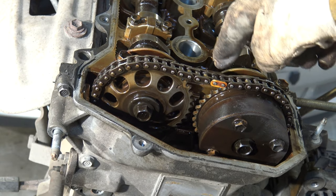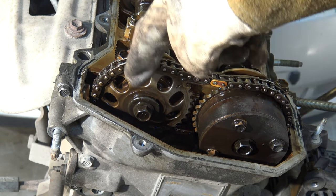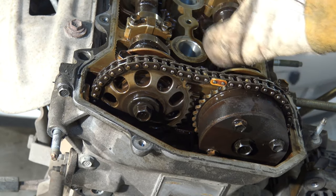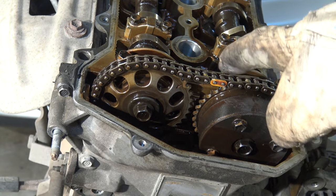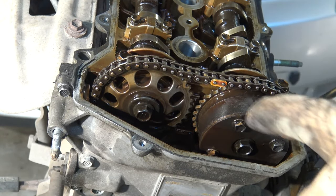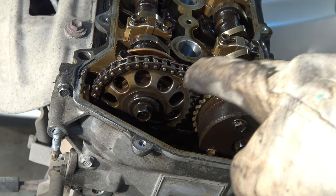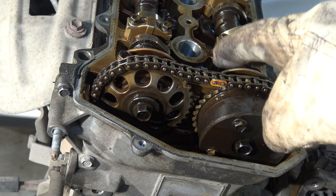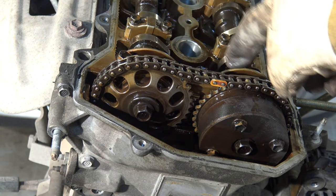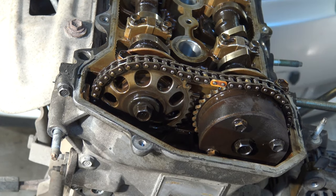Kaizen is an improvement idea, that this yellow label goes to these timing points. It is excellent Toyota engineering. And these are all made so that when they assemble in factories these engines, the workers install these chains in the right position using these yellow markings.